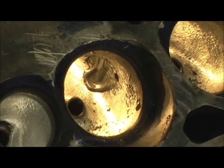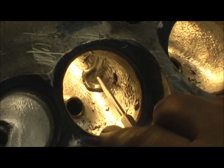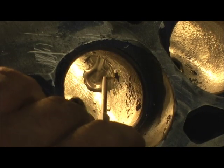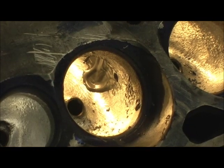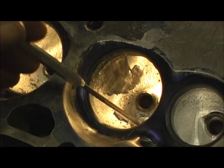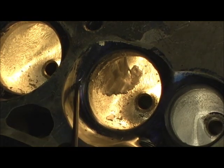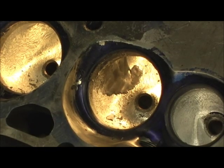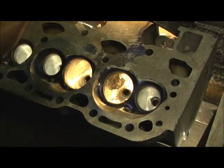As you can see, it's epoxied up pretty good — I really splash it on. It's no problem going in there with a sand roll. I'm just wanting to make deadly sure that in the crevices — that's why I took my finger and pushed to get any in there. Let's take a look at the other side. Same way over here, all packed in and pushed. There'll be little pieces I've got to get out with my scribe, and I've got to go up in here and clean the passage out for the head bolt.